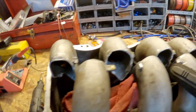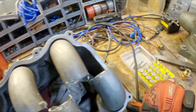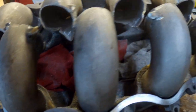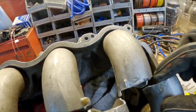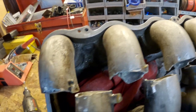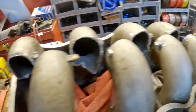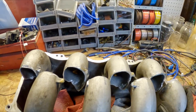So it still ain't pretty, but it's a lot prettier than it was. I've been spending a lot of time with the Dremel, grinding stones, and files, getting all of this as cleaned up as possible, trying to smooth out the entrances on each of the runners and trying to take out all the rough edges and burrs from cutting. I still need to go over just a little bit more, but most of it's pretty solid. I'm mostly happy with what I got here — I don't think any of this extra stuff is going to hurt the airflow too much, at least I hope not. I'm not a professional and I don't have access to professional tools and equipment, so this is the best I can do at the moment.